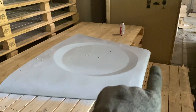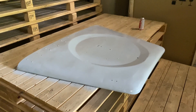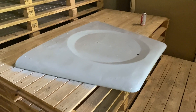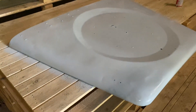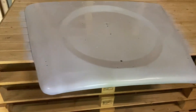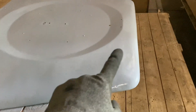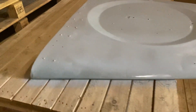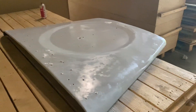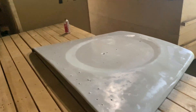I've rubbed the filler down on the front - didn't film that - and I've brought it around the back on a palette to do some undercoating. Etch primer brings up all the imperfections you can't often see when you're sanding. You'll see there's a bit of a dent there as well. It's basically a pretty beaten-up bonnet, and there's a little raise on the left-hand side.